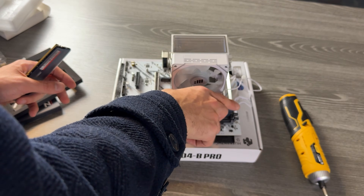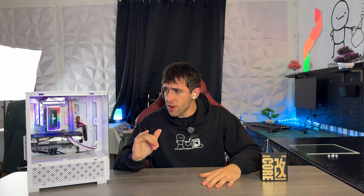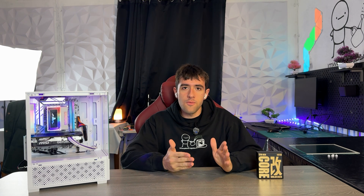If you simply unlock the two power limits — I will have a full tutorial on how to play around with the CPU settings — you're going to have a beast CPU. You are not going to reach i9-12900K performance out of the box unless you delid it. To really reach it, you would have to take off the lid and direct-die mount the CPU with liquid metal, which I don't really recommend just because the level of time, effort, and extra cost defeats the purpose of buying this. I think if you're buying this, you want to simply mount it in a build with a very cheap motherboard and cheap cooler, leave it not at stock but just slightly improved, and it's going to be a great CPU.